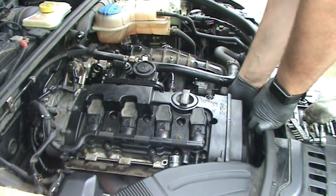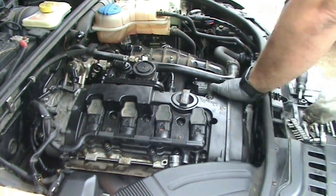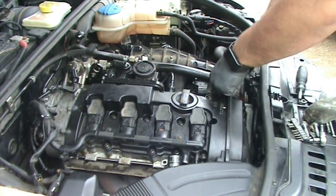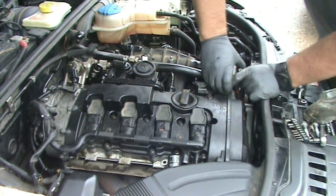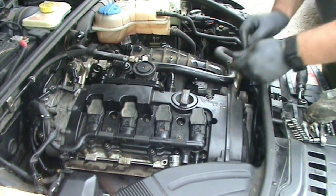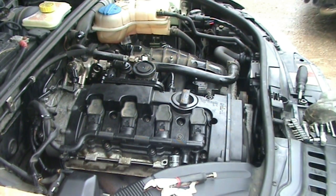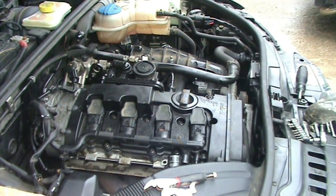And at the same time, I'm going to reconnect that electrical connector down there. And I like these mini vice grips, if I can fit them on the clamp, for doing these types of clamps that are down here, because you can lock the vice grips closed, which holds the clamp open. Then you get the clamp right where you need it to be and release it, and it seems to be a little less explosive than using a needle nose, especially if the clamp slips out of the needle nose and then it springs open, and seems to be a disaster trying to use those.